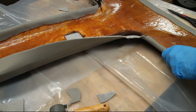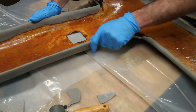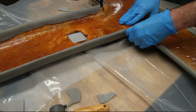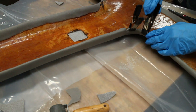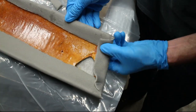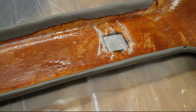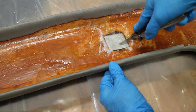The inside corners are the hardest part. In hindsight, it would have been better to make several small cuts and have the cuts wrapped alongside the back, versus the shallow cuts that I made. Cut out any areas such as the dome light or seat belt holes.